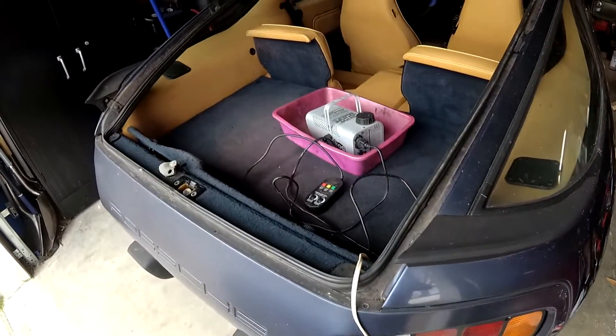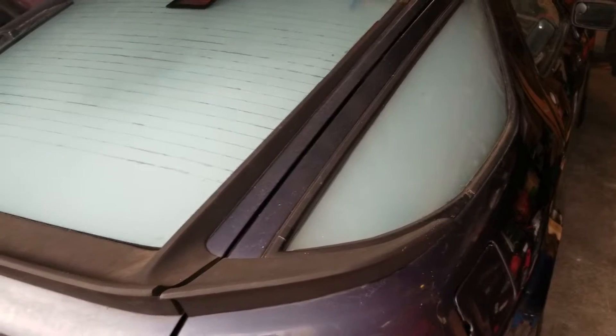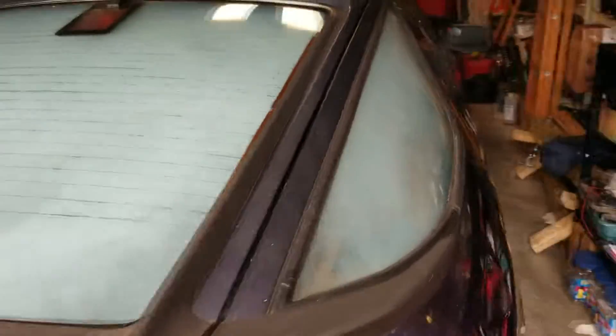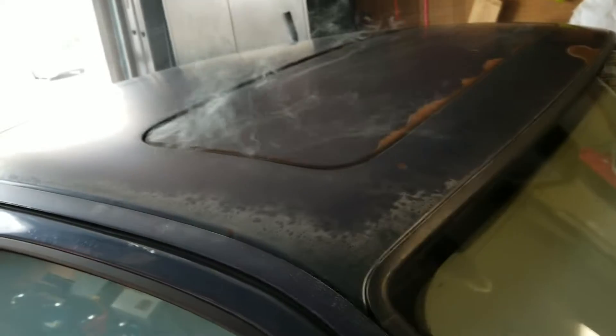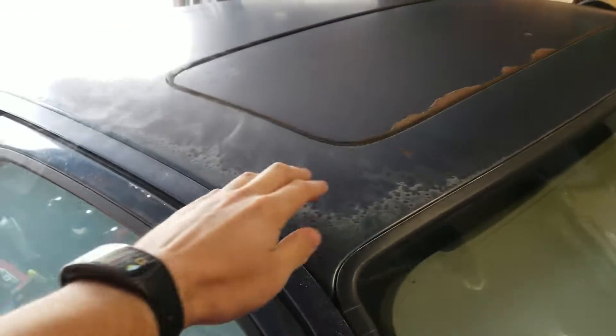So now we just have to wait for it to start making fog. The fog machine is definitely on now, and aside from the bit of fog that came out before I managed to close the hatch, it looks like it's pretty well filled up with fog. Not a surprise, the sunroof is leaking. I can see anything in the engine area? Surprised there isn't any significant amount coming out around the HVAC system. Just walking around looking — it seems like everything that's coming out is just from the sunroof here.